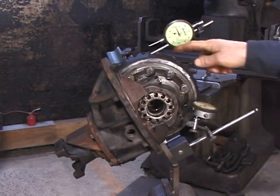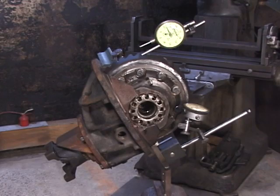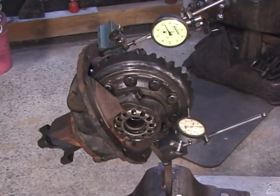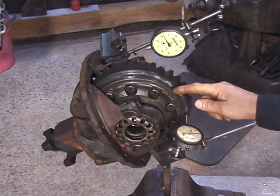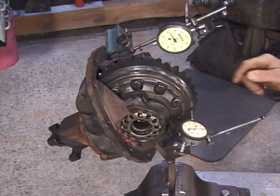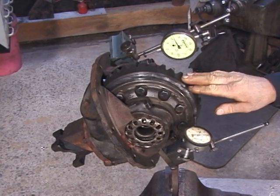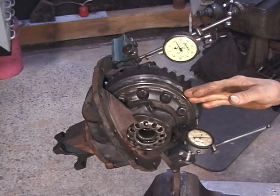Your final backlash check should include measuring backlash at four positions on the ring gear. All four readings should not vary more than one thousandth total. If you have readings that seem higher and lower as you go around the ring gear, this suggests that the ring gear is cocked on the carrier or the carrier doesn't run true. To determine this, mount the dial indicator and check the readout against the back side of the ring gear—this is a ring gear runout check. All the way around should not vary more than one thousandth of an inch. If it does, you must remove the ring gear, check for burrs or anything keeping it from seating flush to the carrier, or replace or machine the carrier to make it true.